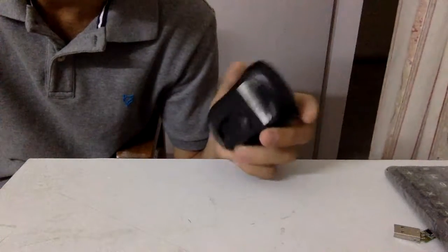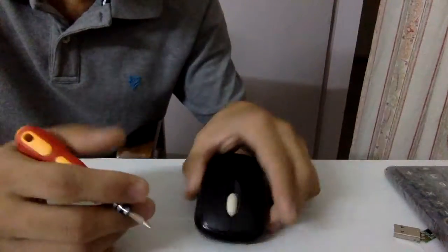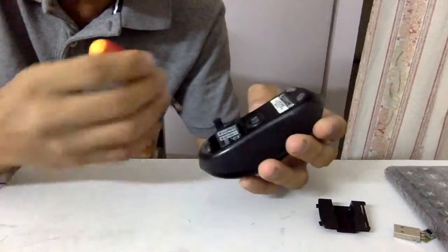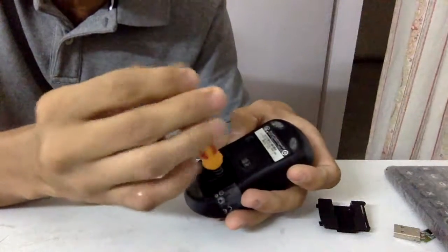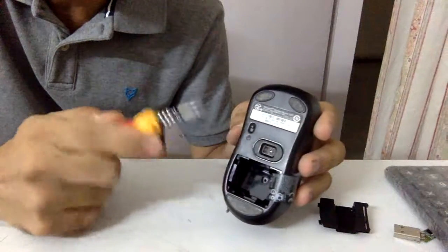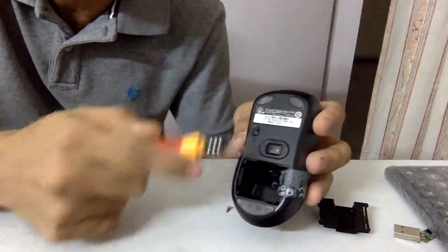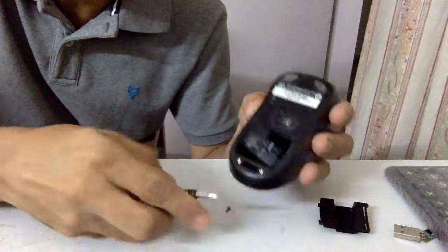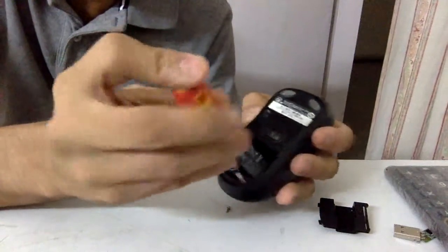Let's get the tools. First thing is to remove all the extra parts, and then the basic step is to remove all the screws. Beware: whenever you open things like these that have small tapes around, always remove all the tapes to check underneath — and there you go, two hidden screws.